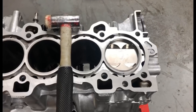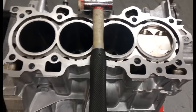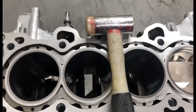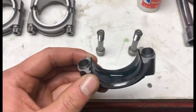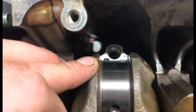Just gave the bore a light lube with some oil. Obviously the smaller cutouts are the exhaust side. I've clamped it like that, gonna slide the piston in. Got a bit of lube on the bearing, assembly lube, and tap it in. Just tapped it in using a nylon mallet - that one went in lovely. Now I'm gonna line up for the fourth one.